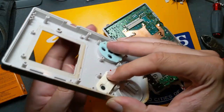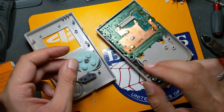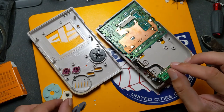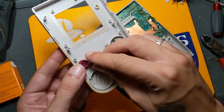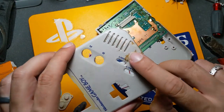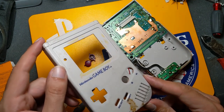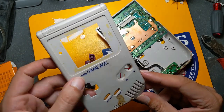Before we move on to reassembly, I definitely want to clean this case up — it is crusty. The best thing for most of these I find is to just use some warm water and soap for the rubber pads and everything else. Warm water and soap really does a good job of getting the majority of the gunk off these things. Anything that's stubborn can be followed up with a little bit of alcohol. I have a feeling this is some glue from some tape, so this is most likely going to require a little alcohol. I pretty much start with warm water and soap and go from there — anything I can do with just warm water and some dish soap is a plus.